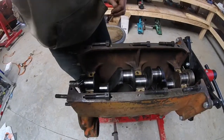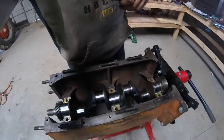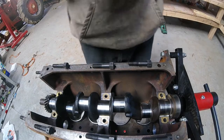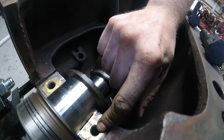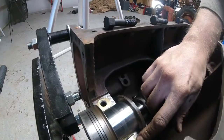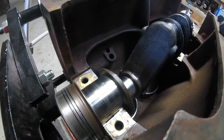It's probably hard to see on the GoPro. The Plastigauge is in there — the front two bearings are open but good. The back one — here's something to watch out for, because it just happened to me: this shim worked its way under the bearing, and that will hold the whole thing open. That's obviously the oil groove area, but that's why this one had excessive clearance. When you're torquing it down, make sure the shims stay out of the bearings.